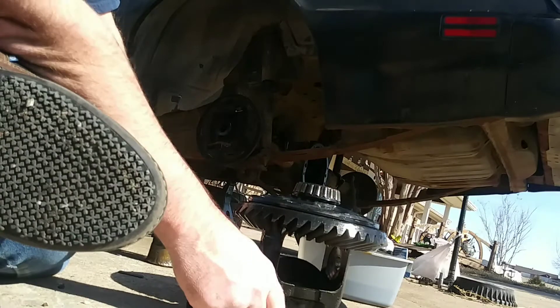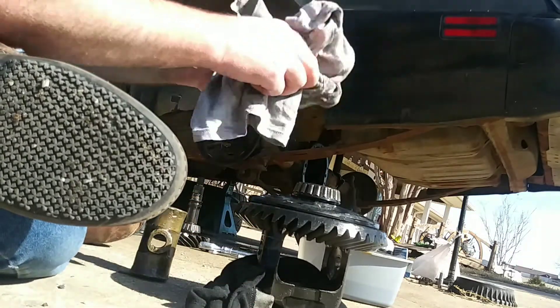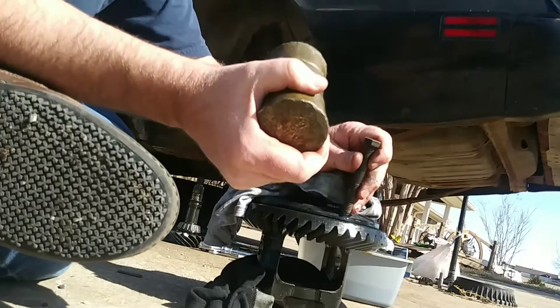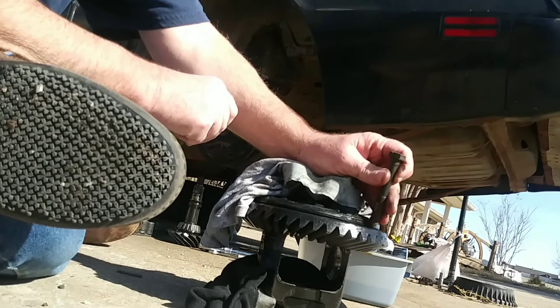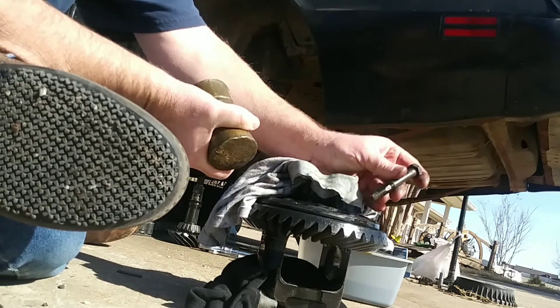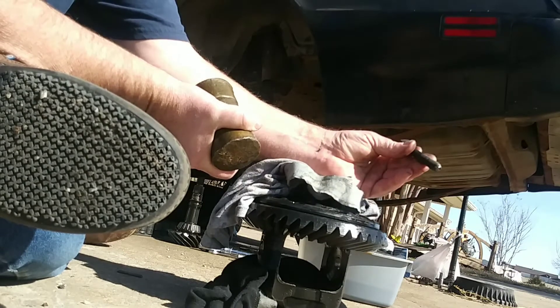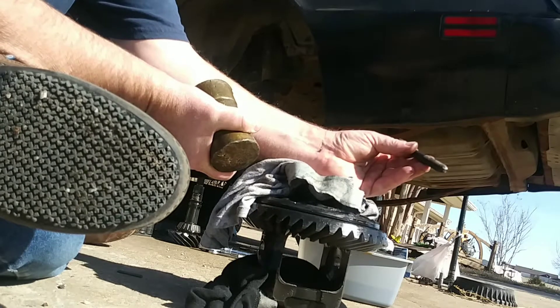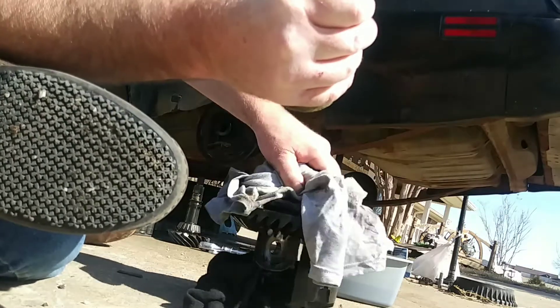Now, we're not reusing this race down here, and this might turn out sloppy. But once again, the brass hammer. See the back face of the gear — it hangs past the differential. That is where you would use a dual-ended chisel with a rounded end, not a sharp one. Or in this case, I use a GM control arm bolt because they're tapered a little to make a dull punch. See, it's already coming loose.